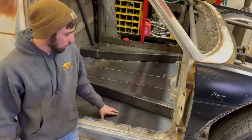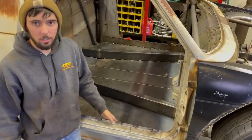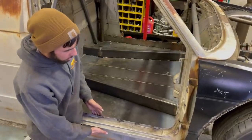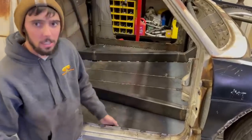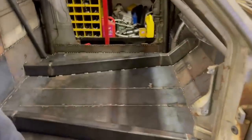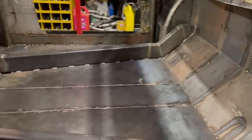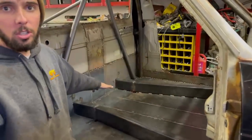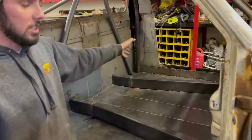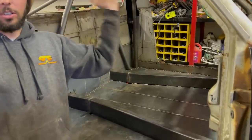The first thing I did was cut the whole floor out, the whole firewall out, and the whole door rockers apart. I planned out a new piece of sheet metal to cap the rockers and make it stronger on the insides, and I put a new floor in — nice eighth-inch plates — so I can weld the roll cage and the frame rails right to the floor and have it act as a good diaphragm. Then I did the firewall up front, and after I had a new structure that was nice and strong, I put some bracing inside and used a laser to cut the whole truck right down the center.